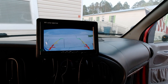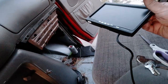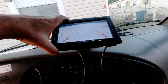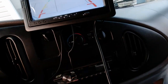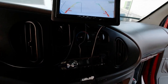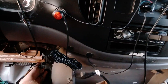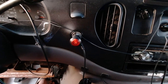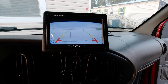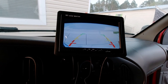We have a screen working! I took the old screen out — this new one is still in its mount, but I have the wire hanging down right now just testing. I don't have it hardwired in yet. This unit has a feature where you can plug in a cigarette lighter adapter to power it, so just to test it I plugged that in and there it is — it does work. It looks like I've got a little bit of the hood showing back there, so I've got to move the camera and figure out the angle.